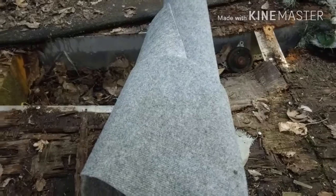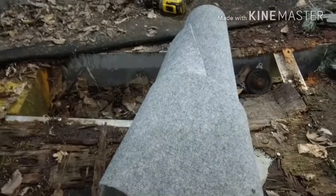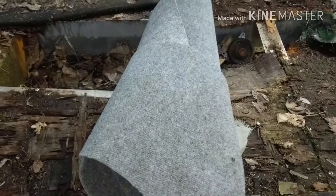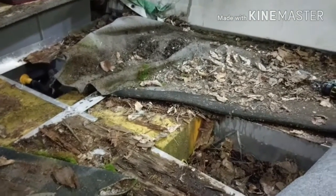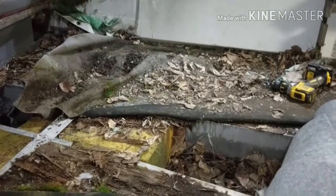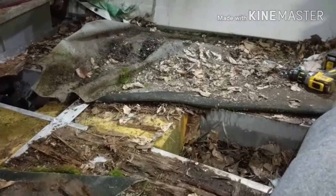So if you do a floor in your boat and use regular plywood and you don't seal it and you just want to see if you like it, by all means go with the cheaper outdoor everyday carpet, because you're planning on redoing it anyways, right? Why stick the money into good carpet? When you have your build set in stone and what you want to do, go with marine grade wood. Never ever ever use green treat in aluminum boats. It eats through it. I actually like to buy boats that people have destroyed with green treat, because I get them super cheap and I fix them. So if you do that, you keep me in business, or keep my hobby going, I should say. But that's the difference between marine grade and everyday outdoor carpet.